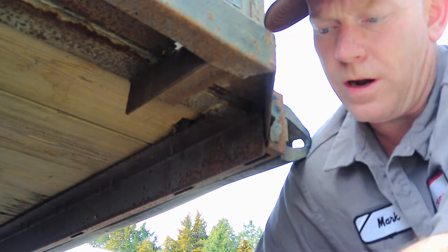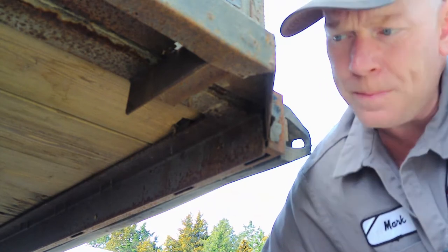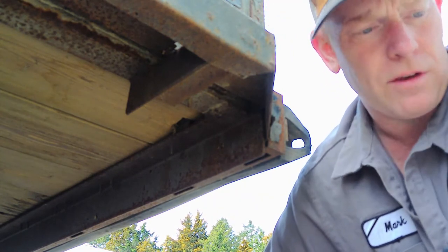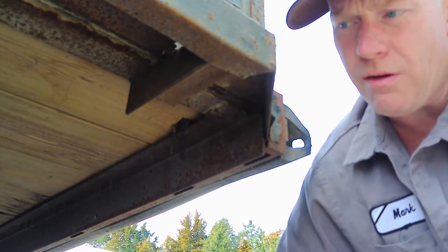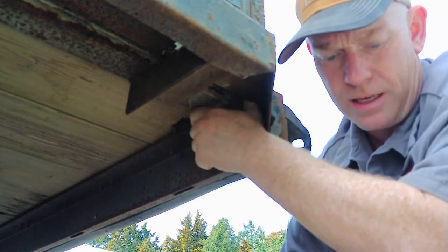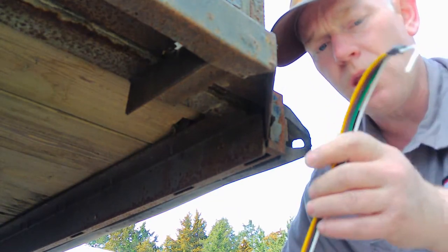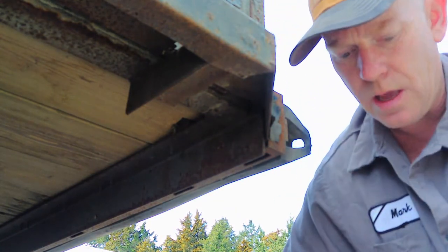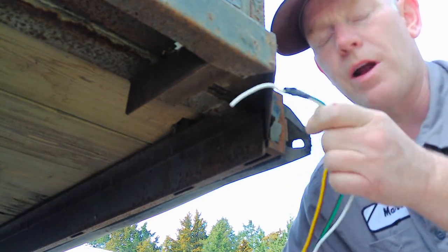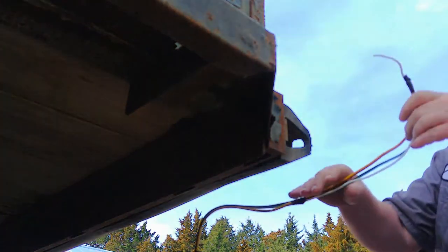That's just an extremely half-assed job of running a wiring harness. I don't have the time to do it right and pull out all the old wiring and run it through all the existing channels. I need the lights to work now and I have to use this trailer. So now we've got it to the back. There are channels that run up to the tail lights, so we've got to run each individual wire up into there. Now we've got to split the harness into its two individual pieces — there's going to be green and brown, and yellow and brown, plus the white for ground.